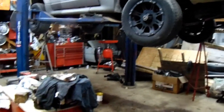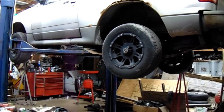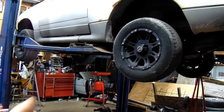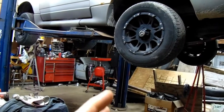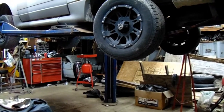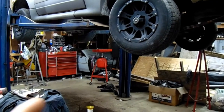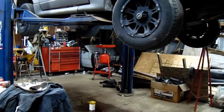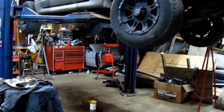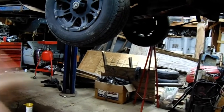What's going on YouTube, Fuzzy Wuzzy here playing with my old crusty 2001 Explorer Sport. My four-wheel drive doesn't work — it's spotty. You turn the switch and you can hear the solenoids clicking in the little corner in the passenger side footwell. Common problem; I think the control module is going out. I've been looking for the part but can't find one because it's a common problem, so I'm just swapping to a manual transfer case. I'm tired of dealing with this — I'm just going to cut a hole in the floor, put a stick in, and be done.